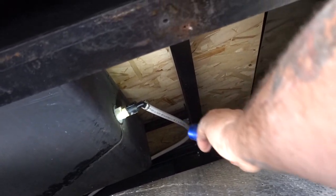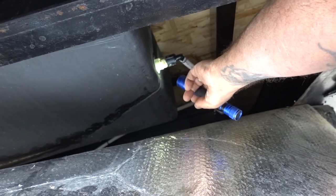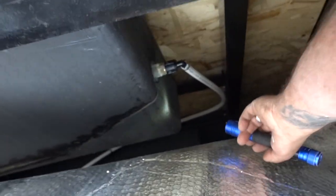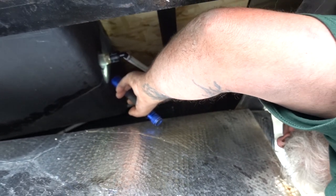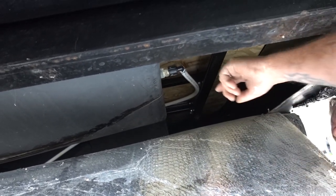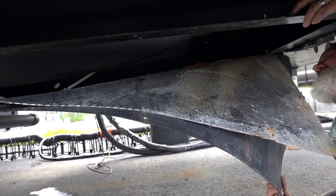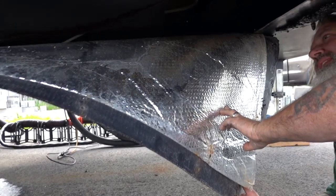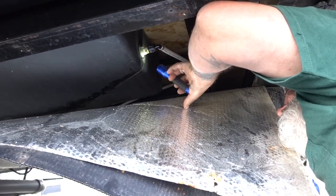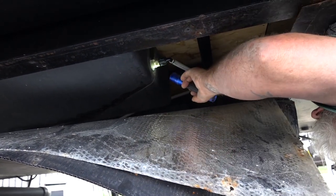The valve right here is cracked — the piece inside the tank is cracked. Does that need a new tank? Yep. The other option is to try to grind it up and put some epoxy on it if you don't want to replace the tank. Do you have a warranty? If you look right there, there's a crack. You could possibly use something like a Marine JB Weld — grind it up, clean it, put it over the crack. But that's a non-serviceable part. So the only way Beckley's will fix that is to replace the tank. Is it possible the black tank flush pressure is causing the leak?